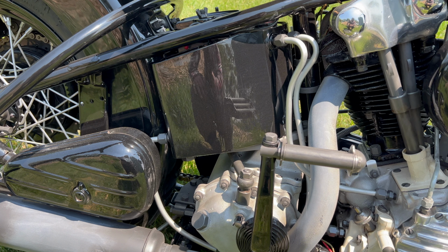It just looks beautiful. Oil lines, they're kind of like tin plated. And then the nuts are Parkerized. It's a wartime thing. The vent line always goes on the outside. The return line goes on the inside fitting. And the feed line goes where it always goes.